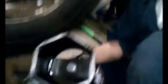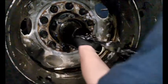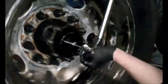The lock nut and the jam nut take a special socket — might be the biggest one in the world, but go ahead and slap this on here. And you want to do this while the wheel is spinning, that way you know the bearing is seated correctly and the wheel doesn't lock up. With my click there I know it's at 200 foot pounds.